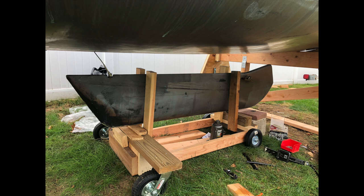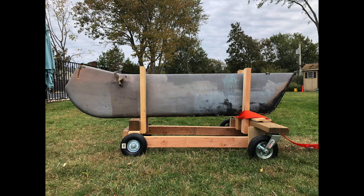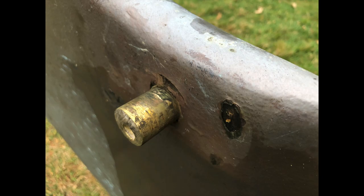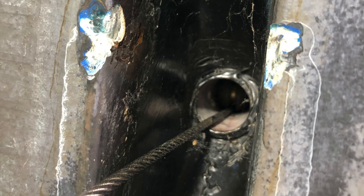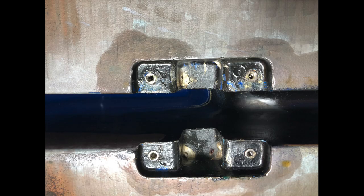Once the keel was down, I released the cable and carefully dragged the keel into my garage. I took off the hangers and labeled them starboard and port. Luckily my keel pin was in really good shape, so I was just going to leave that alone. I inspected the hull where the keel cable had rattled around — that was some hull repair I was going to have to do at some point. Luckily the weldments and the trunk were in really good shape, so just good luck on my part. Take the wins when you can.